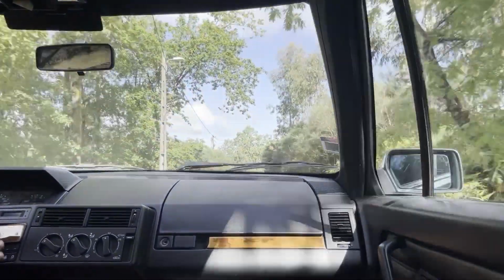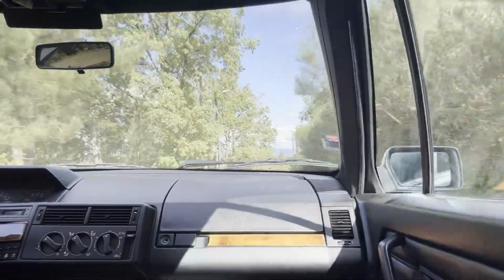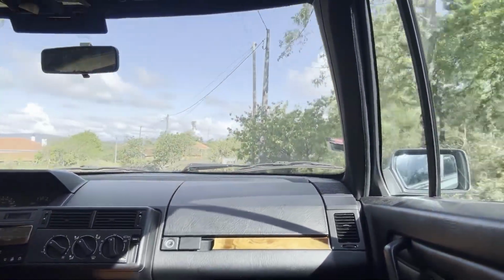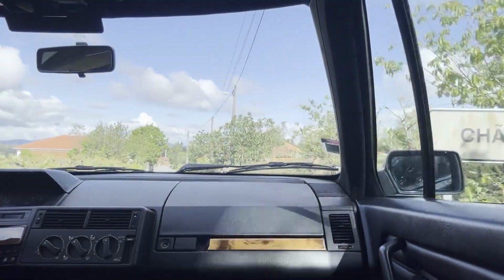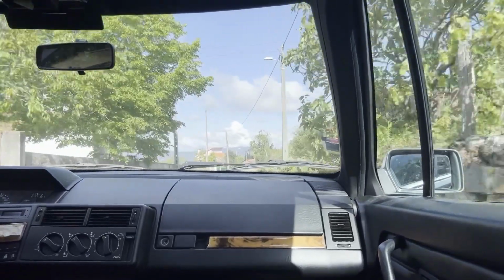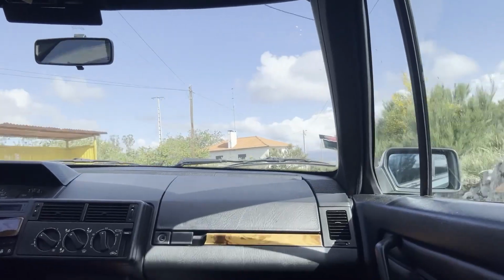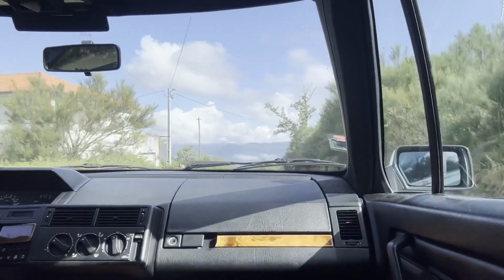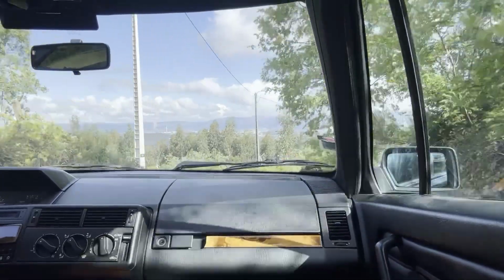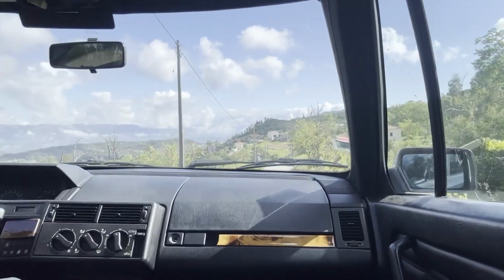So, first impressions. Steering wheel is off. It's not catastrophic, but it is off. It feels very light too, lighter than before, which is to be expected since I probably messed up the alignment. I didn't put the outer tie rods exactly where they were. I haven't felt that resistance and that knock yet, but we are going slowly. My test will be going up this road because that's where the issues started last time.